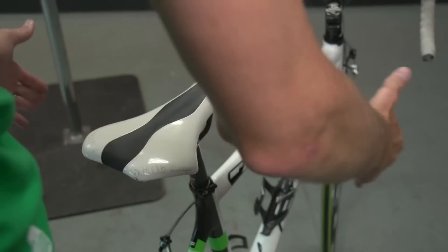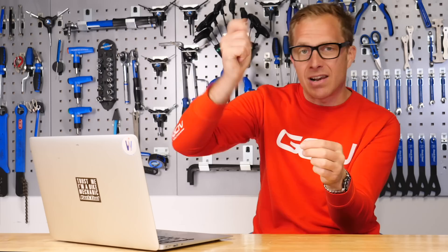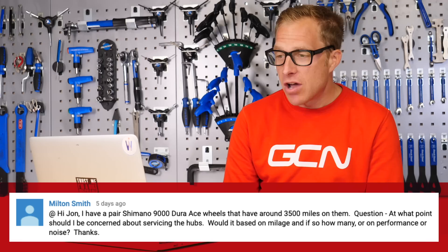Ben, I feel your pain — you want to go riding on holiday on your own bike and there's nothing better than that. I'd suggest using something like WD-40 or a rust penetrator, spray it into that internal wedge seat clamp mechanism and allow it to soak in — hopefully that'll break the corrosive bond. It's normally caused when an electrolyte becomes present between two materials and fuses them temporarily, sometimes permanently. Allow that to soak in for a couple of days. If not, get an Allen key in there and gently give it a few taps with a toffee hammer — a very small hammer that can't put too much force through but can sometimes break up the bond. Sorry if any of that anti-rust stuff goes down into the seat post and destroys your bottom bracket, but take out the cranks and mop up any residue.